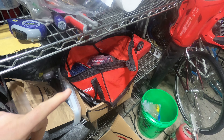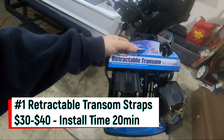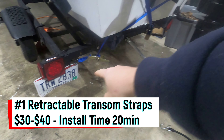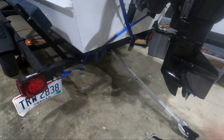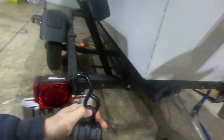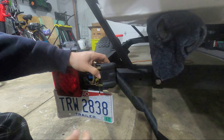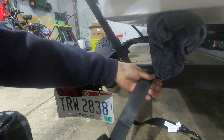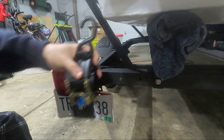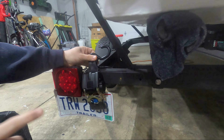Something I've really been wanting to install are retractable transom tie-downs. Normally when you tie your transom off, you have a hook on the bottom and a hook on your actual transom. As a replacement to that, these are retractable transom straps. You push the release to pull the strap out, and when you're ready to have the strap come back in, you push a button and the transom straps retract back into their containers. Everything is self-contained to one unit on your trailer and you never have to take your transom straps on and off.